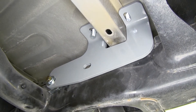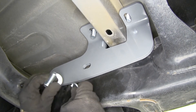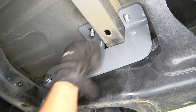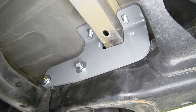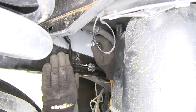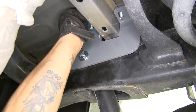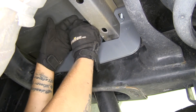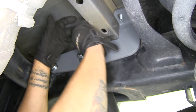For our rear mounting hole, we take a shorter half inch bolt from our kit followed by a half inch lock washer, then a half inch flat washer, and thread it in place. On the driver's side we do the same thing — making sure to put two spacer blocks in between the dip in the frame. We then take the offset square spacer, slide it over the bolts passing through our bed, and secure it with a half inch flange nut, leaving these hand tight for now, repeating for all bolts coming through the bed.